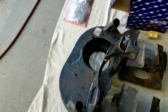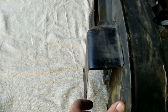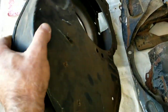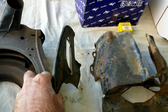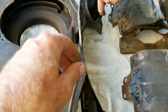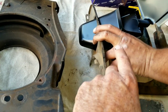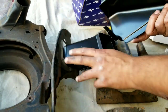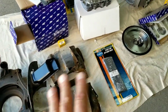The doghouse fan shroud is the only way to go for a bulletproof engine. Real quick, I'll show you: the doghouse has the cooler mounted on the back and it has its own exit point. All the air exits out that little piece that goes on the back side and actually exits out this port right here. When you have that, you also have to have this tin — absolutely. This connects so all the air goes up to the front of the engine and then goes to the back of the car.